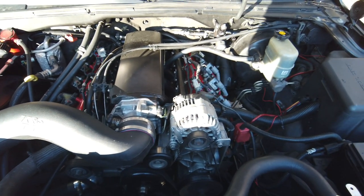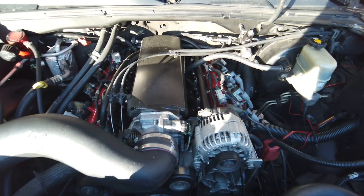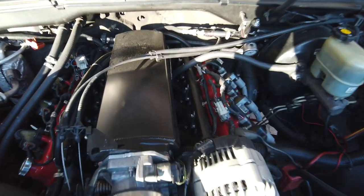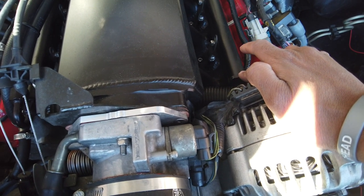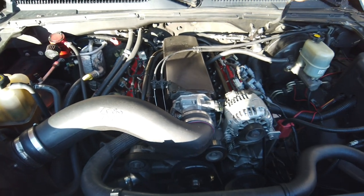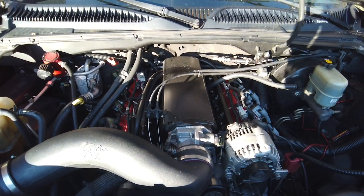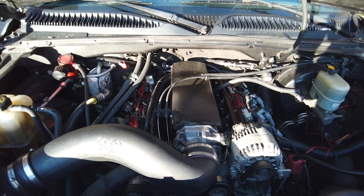The biggest thing that I want you guys to remember is assembly of the setup. Get your assembly, get the injectors and fuel rails on. Like I said, you might as well throw this cap on because you're probably going to deadhead your system. I've even seen guys who are running big horsepower setups, even on the Holley Hi-Rams, because you got to think, this particular positioning is the same on all the engines. Holley Hi-Rams, I've seen guys think they can make that turn and you can't. They had to deadhead it here. So that's pretty much a general rule of thumb.